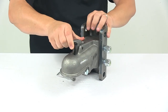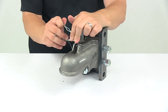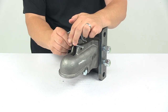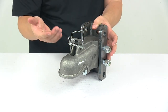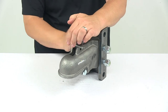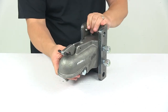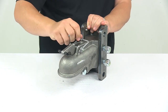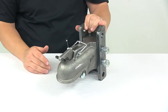This can also be pinned back to the open position. You just pull that back, place the pin in the groove, and then the latch will rest on top of that. That holds it in the open position for even easier connecting. Then when you're ready to secure the hitch ball, allow the latch to drop back into position and take your pin and clip to secure it. That prevents the latch from accidentally opening and releasing from the hitch ball.